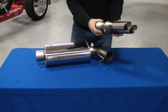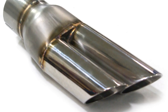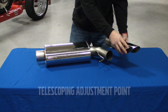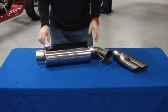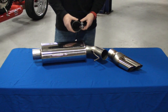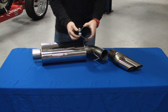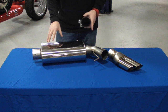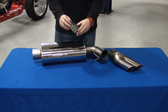Our tip also has a slip section that allows for adjustability to line up the tips for the rear muffler. It slips onto this elbow piece and gives you a little bit of adjustability so you can line up the tips to your choice exiting the rear bumper assembly. One last thing included in the kit are these 3-inch stainless steel exhaust clamps, which go at all the slip joints. Since our exhaust system is T304 stainless, it's only natural to include a really nice high-end stainless steel clamp.